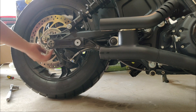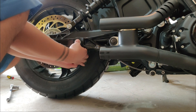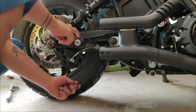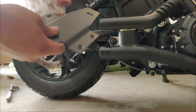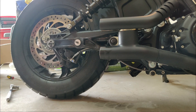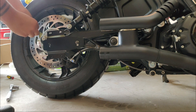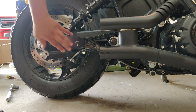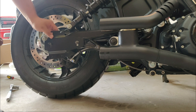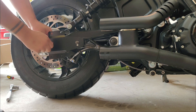These are the black ones and they're going to go here. This one has a spacer, this one did not. Leave the bracket loose for alignment. They issue you this bracket — I'm going to throw that on there. They also supply these two bolts. Per the instructions, put it on the existing hardware loosely, and make sure the bracket's arrow part is going to the front of the bike.